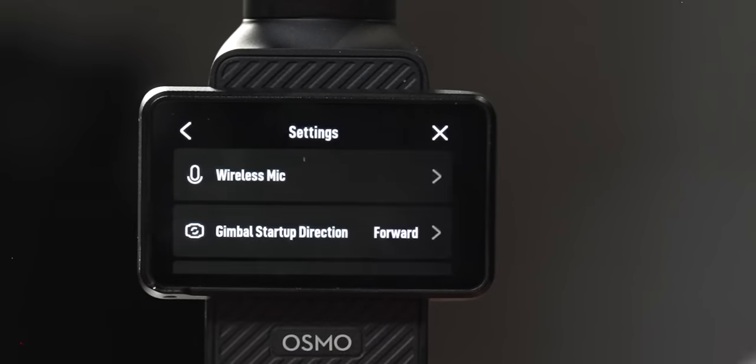The next option in your advanced menu is LED — turn this off to disable the LEDs on the camera and gimbal. Underneath that is continued live streaming, which lets you live stream from the Pocket 3 through the DJI Mimo app. You also have language, format (to format the memory card — DJI wisely put this deep in the menu so you can't accidentally format it), factory reset, device info, and compliance info. There's a ton of functionality right in the gimbal itself without needing to connect to a smartphone.